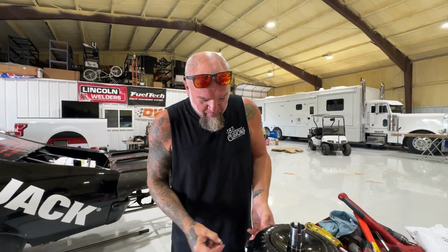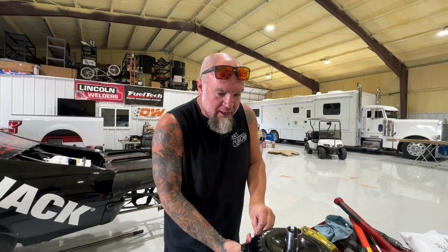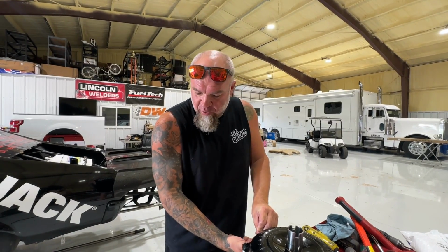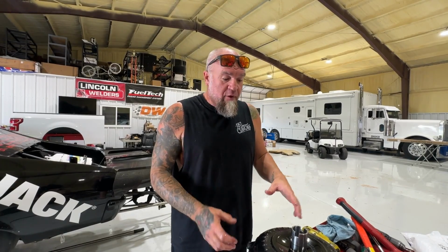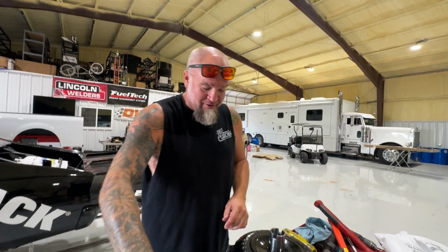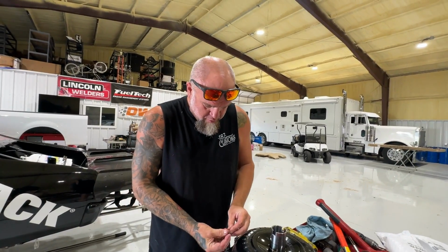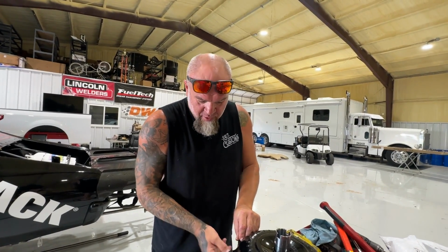So he cuts the dump on. It didn't change anything. Everything was exactly the same. I look through the data, and you can see that it actually cut the dump on because the transmission pressures changed. But I did pull the converters apart when I got home, and even though they're alien to me, I looked at them and didn't see anything wrong. It's got to be the transmission. I think we got some premature pump wear when the bell tried to fall off of the transmission in California.